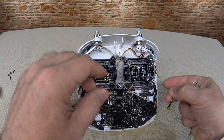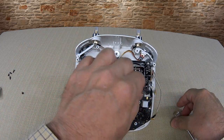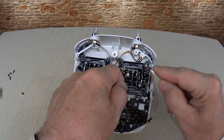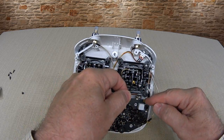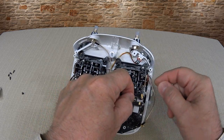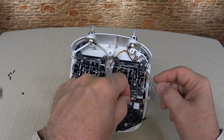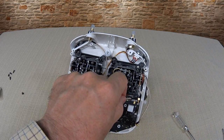Okay, so now that those cables are through, we've got to connect them to the main printed circuit board. That's a pretty easy thing to do. If you look at the cable end, you'll see that it's got a circular connection out here. It's got a hole in the center. The mating connection down here is a circular piece you're going to slide it into, and in the center that's a pin. So you need to make sure when you put this thing in that it's completely square when you push it down, and you should feel a physical pop when it goes into the connection. You'll actually feel it seat itself. That way you know it's in there all the way.